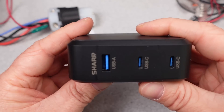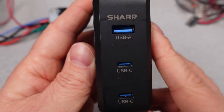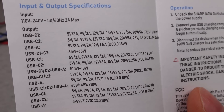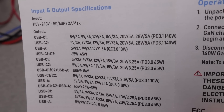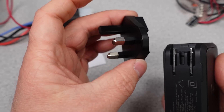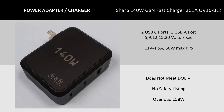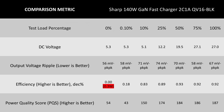The 140 watt charger is last — this is the big one. It is noticeably different than the other chargers in a few ways. One: it lacks a safety listing. I'll look at the thermals later on. It does offer something I actually like in that it will share the two USB-C ports as two 60 watt ports. It won't deliver 140 watts this way, but at least it can charge and power two moderate sized laptops. The power performance was not great at the low end — the idle power was a bit too high, and voltages were actually on the high side, which is unusual, so regulation was also a little weird. The ripple was low, and the efficiency was fairly high in the middle range and up through the top end. Actually, efficiency wise, this does better than most other 140 watt adapters.